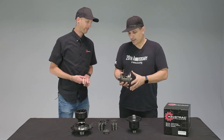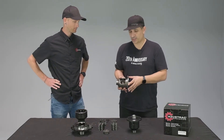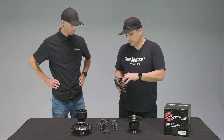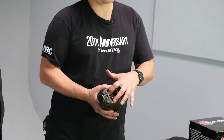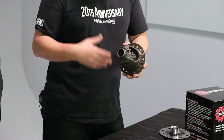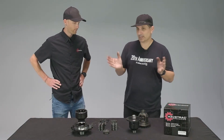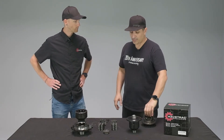This is one of the weak links on the RB26-powered GTRs — your R32, R33, R34 GTR. If you're making over 500 horsepower, make sure you upgrade this. The reason is just the amount of contact area between these little spider gears and side gears. When you make over 500 horsepower, it explodes, puts a hole in the front housing, and can take out the whole engine.